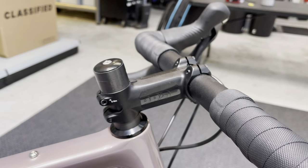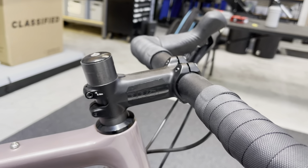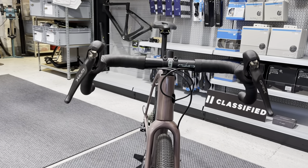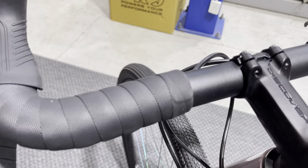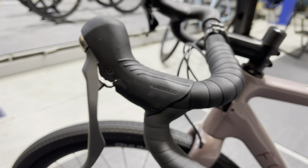The cockpit, as with all our gravel bikes, is a ProDiscover handlebar stem in a 90mm — as it's a pre-build we've chosen the most common size for a 54, but we can change that to suit the customer. It's got a ProDiscover handlebar with a 20-degree flare, finished in 3B bar tape — BHT 16, 3.5 millimeters — which gives loads of comfort with a gel built into the tape. Standard finish for us, with matched ends and a figure-of-eight wrap around the hoods.